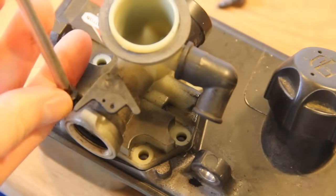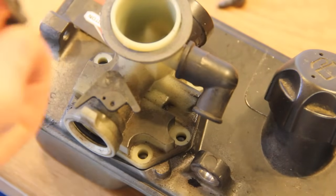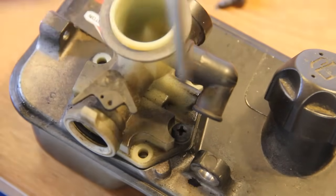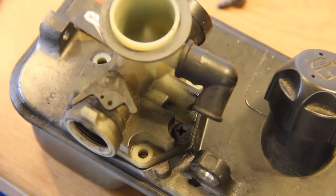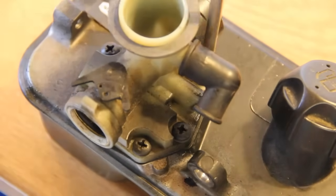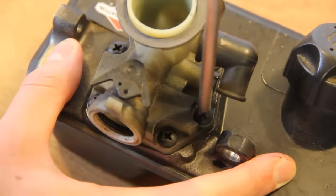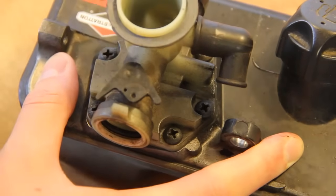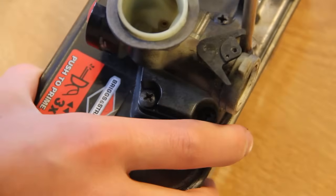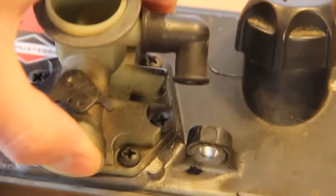Same as when you're removing it — just put one in at a time, and then screw it up a bit, but do not tighten it. You just need to put each one in loosely, then work around, and when you've put them all in, you can then tighten them up. There it is — the gasket and diaphragm is now installed and I've put the carburettor back onto the fuel tank.